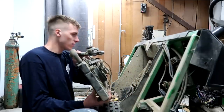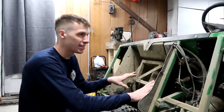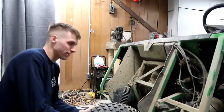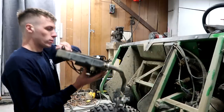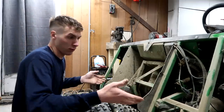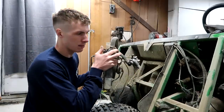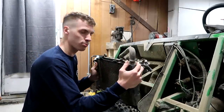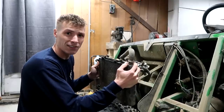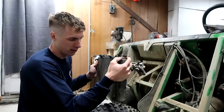There's this nice little cavity right here. However, we can't mount it to this face because this face moves with the wheel. You can't have a radiator that moves with the wheel. So I've gotta remove this plastic, build some sort of frame, but at the same time make sure that when we swing far to the right or far to the left when we're ripping the hell out of it, our radiator doesn't get compromised.